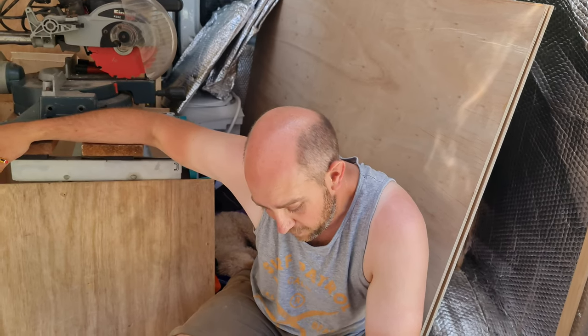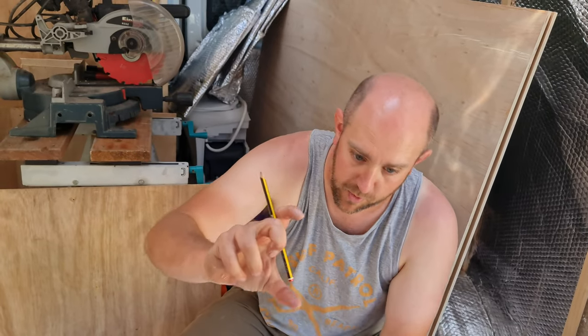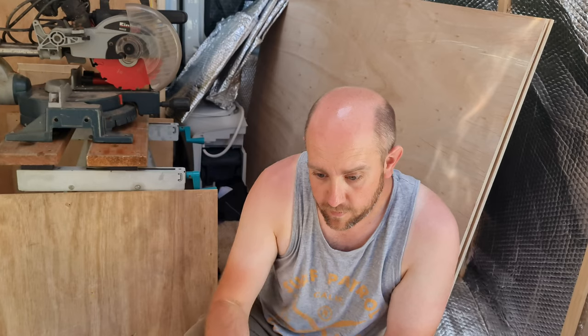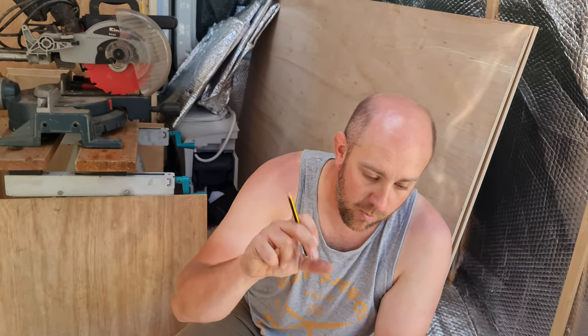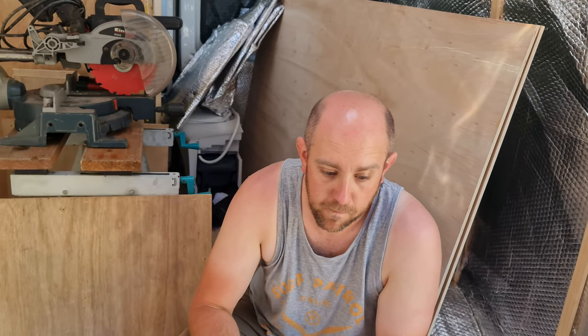Yep. That'll go through the van floor, and that'll sit underneath with a washer, then a nut, so we'll have a nice, big, chunky fixing. And hopefully that will be nice and safe. Well, it should be nice and safe. It's going to be a nice big sandwich that it'll bolt through and it'll compress, and therefore we should be tickety boo for the seat fixings. Cool.